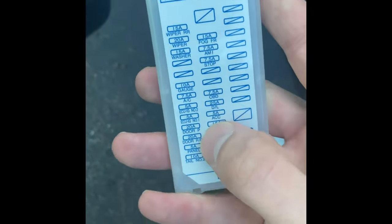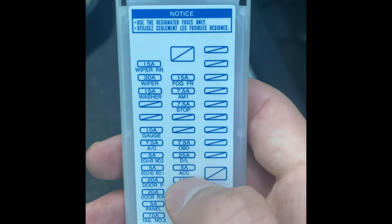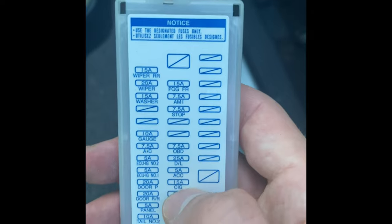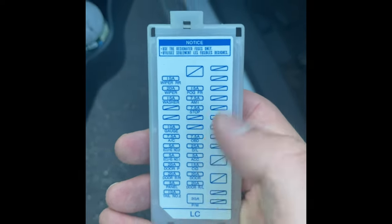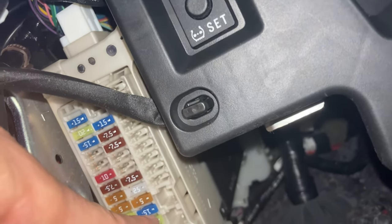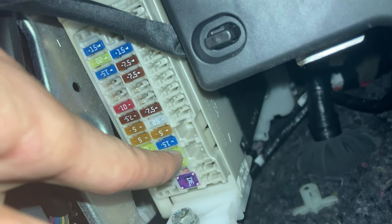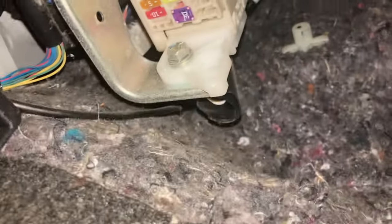It's a little hard to see, so the first thing you want to do is locate where it is. As a reference, you have your panel right over here. What you're looking for is the 15-amp fuse. The 15-amp fuse you want to check is right over here — this is the one that should restore function to your 12-volt. Thanks for watching — like, share, subscribe.